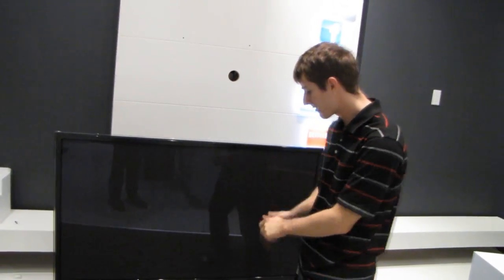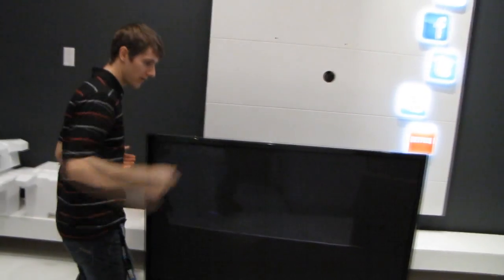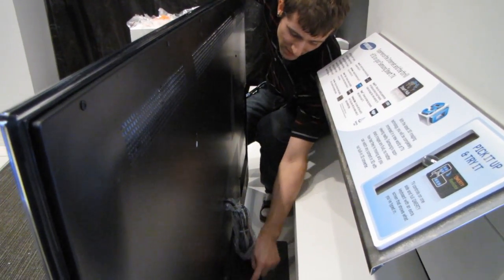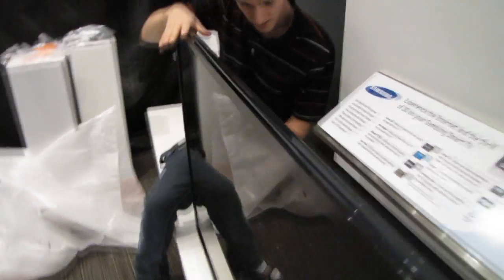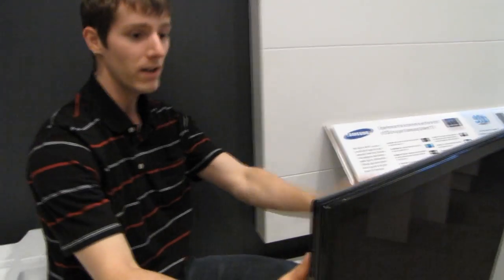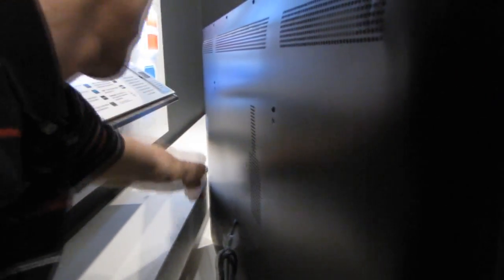Installing the stand took us about 2 minutes. If you want to come around and have a look at the back from the other side, you take this bracket right here, keep the TV sitting upright, and you can slide it into place without even picking up the TV at all. Then you screw on the 4 screws here, position the base wherever you want to put it, lower the entire TV down, it balances, and then you put in the 4 screws here. Oh wait, actually that's not the way you're supposed to do it. You're supposed to put this onto here first, that way you can put in all 4 screws. I only put in 2 screws, but it seems to be okay. It's not going anywhere for now. Bear in mind, the way that I would be mounting a TV like this in my home is using a wall mount anyway. It's so slim, you might as well take advantage of all the space in your room, because with a 60-inch screen you're going to need some distance from it. It does have the base mount holes here.